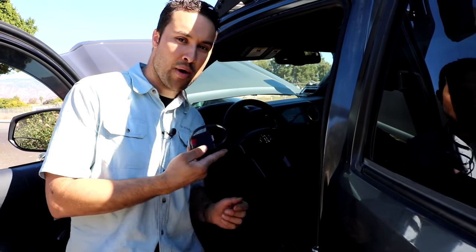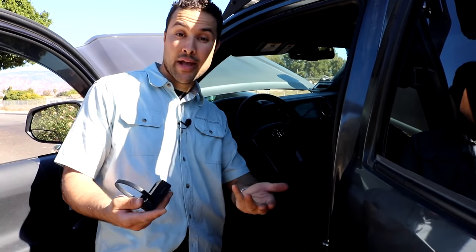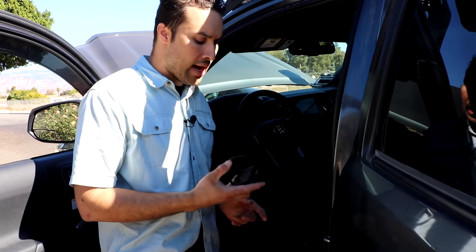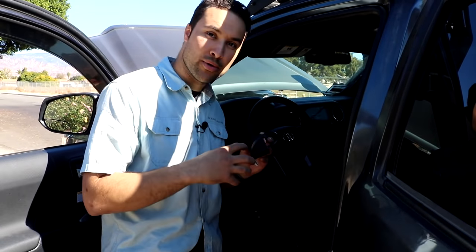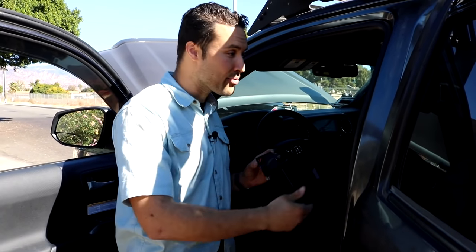This is a reflashing module that we provide for owners that are out in the field, say if they change out their head unit, or in this case, Jesse going from the 18 to the 20. Rather than you having downtime without your system, we would send you this module with a pre-programmed tune on it. Then we just plug this into your amplifier and it will recalibrate the digital signal processor. So we're gonna recalibrate it so that you get the maximum sound reproduction out of your system.